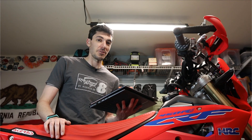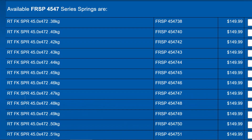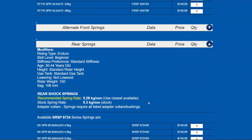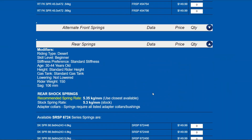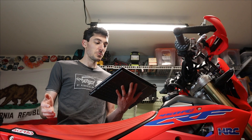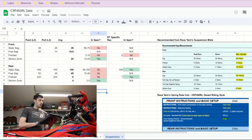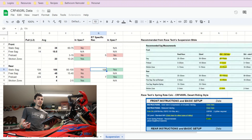There's another section of Racetech I can use: their spring rate calculator. You enter your specific bike, general information about yourself and your riding type, and they provide recommended spring rates compared to stock. After playing with the settings across riding styles — like Goldilocks — I found the one that's just right: desert riding. That's perfect because my dual sporting is open desert anyway, and desert sits right in the middle between supermoto and dual sport. I pulled those recommended front and rear settings into my spreadsheet to compare against my actual numbers — that's also where the 106 mm static sag target came from.